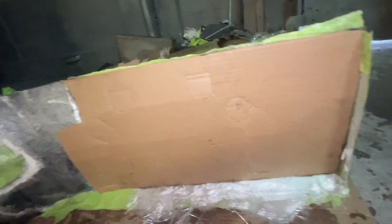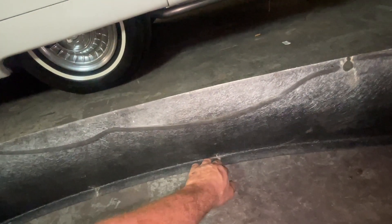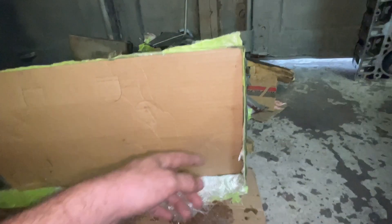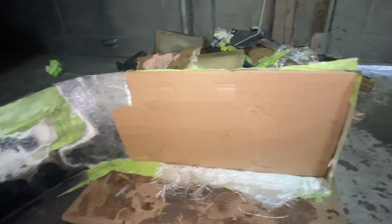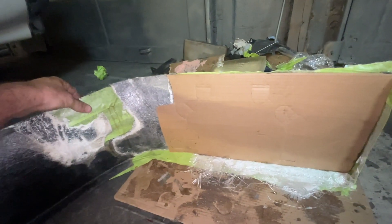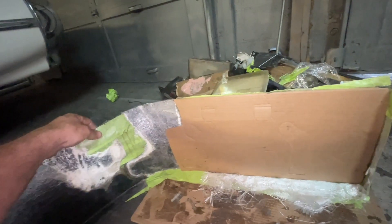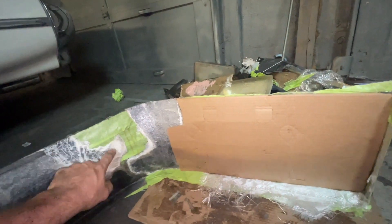This is what'll make it really really strong, so I just need to measure from this point to that point and make sure we're the right distance. I'm gonna fiberglass that and that little spot, but I'm gonna do just the lips right now — we're focused on the lip because that's what makes it strong. Once I get that fiberglass then I'll come over here and it'll have a shape. This right here is stiff right now but I still have to go through and fiberglass this in, box it. I got one layer of fiberglass and resin — it ain't strong enough to keep it from breaking.